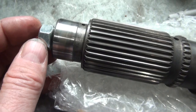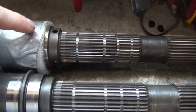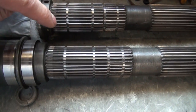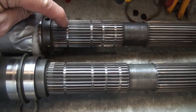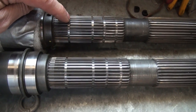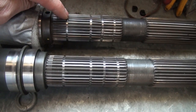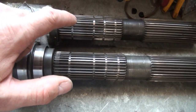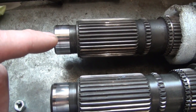I wanted to send it into a machine shop anyway to have these grooves cut into the splines, because this shaft was from a newer truck and it had a different way to operate the speedometer sensor. The speedometer drive assembly goes into this area, so I needed these grooves cut. I sent it to the shop, they cut the grooves, and they also had an apparatus to demagnetize the shaft.